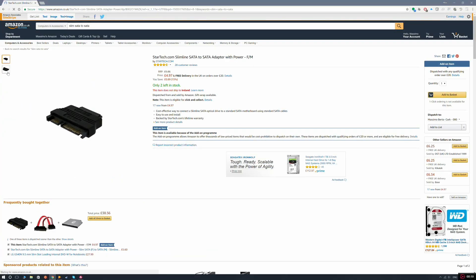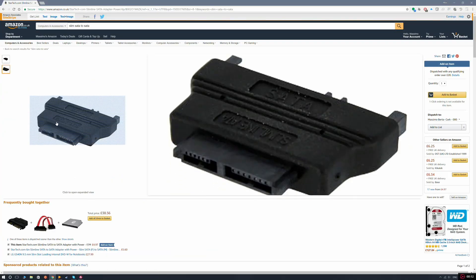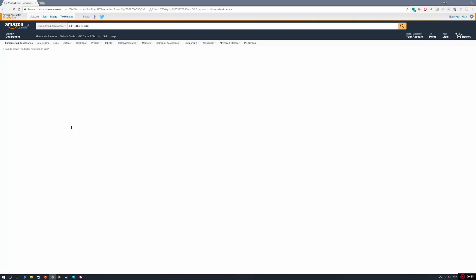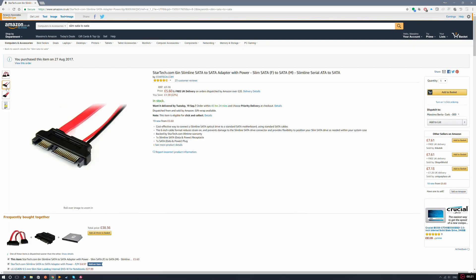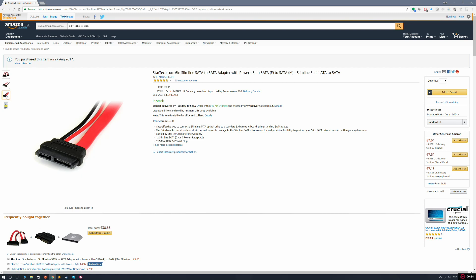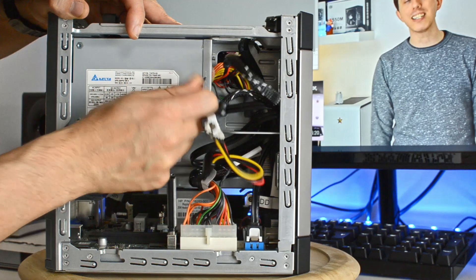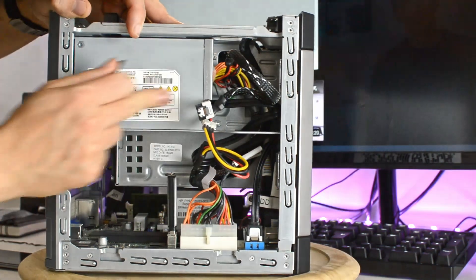Both items are linked in the description below. You can find more compact slim SATA to SATA adapters, but I opted for the one coming with a cable to avoid putting too much strain on the caddy connection and to ensure fairly simple cable management inside the case. The Velcro from the SSD and PSU was removed fairly easily and didn't leave any glue or residues, so I was lucky. There can be a risk with Velcro straps — you may leave glue residues when you try to remove them, so I would strongly advise going with the optical bay.